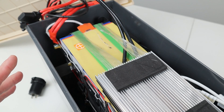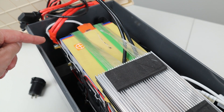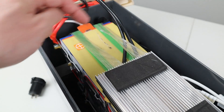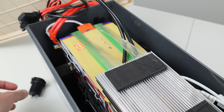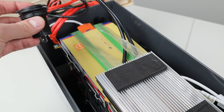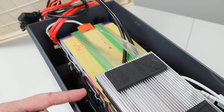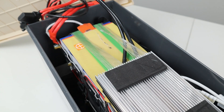I got this modification idea because when I tore down this battery for my initial review I noticed how much room there was between the sidewalls and the battery itself. There's a little bit of room on one side, but the side next to the bus bar terminals is definitely bigger. You can use a bunch of different options here — this is a 12 volt cigarette plug and they fit perfectly down in this area, so you could add three or four of these as long as you have room for your wiring to connect to the main positive and negative.